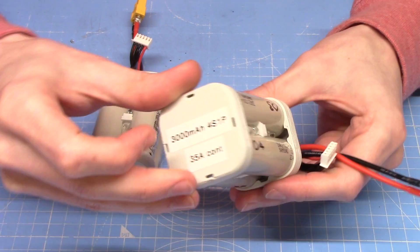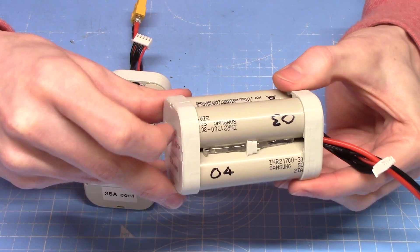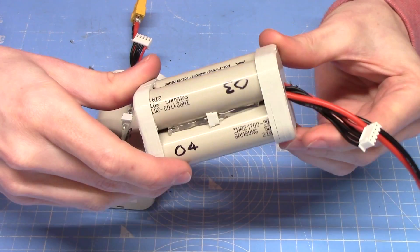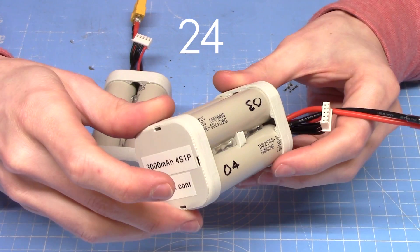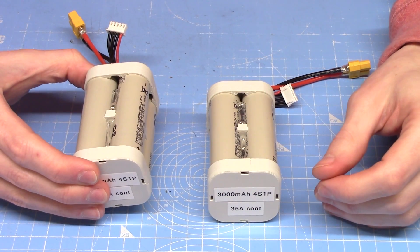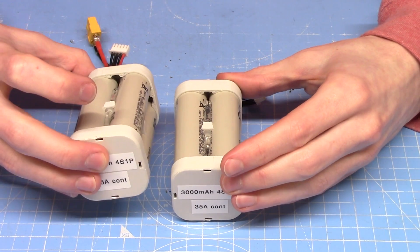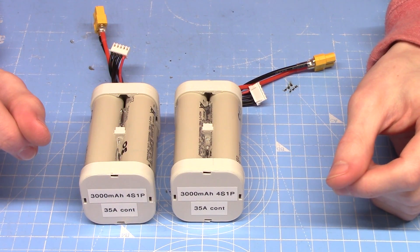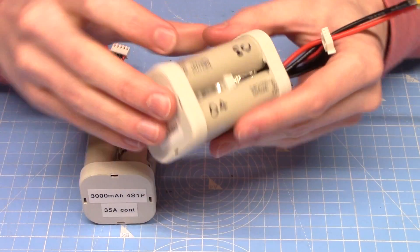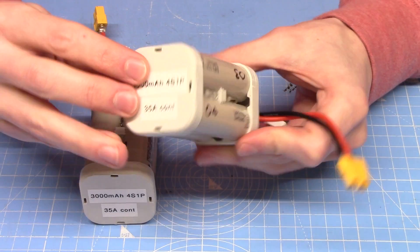I probably won't keep the hot glue down the middle of the cells — that was just there to hold them in place as I spot welded them. I've got some large heat shrink on order to put over the whole thing, which will hold the end caps in place nicely without zip ties. I've got 28 more cells. My plan is to build five packs like this — run them individually on my six and seven inch quad, stack them as a 4S 2P on my macro quad build, and use the 12 remaining cells for a couple of big 6S packs to try on my 5 inch build. 3000mAh 6S lithium-ion on a 5 inch quad — could work!